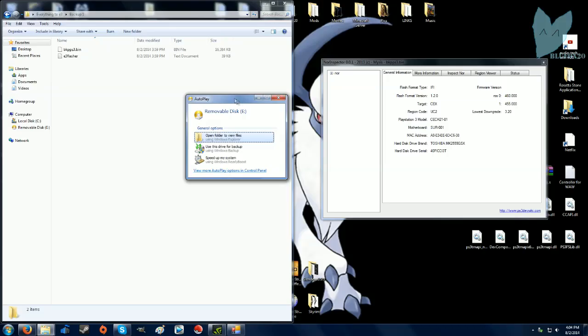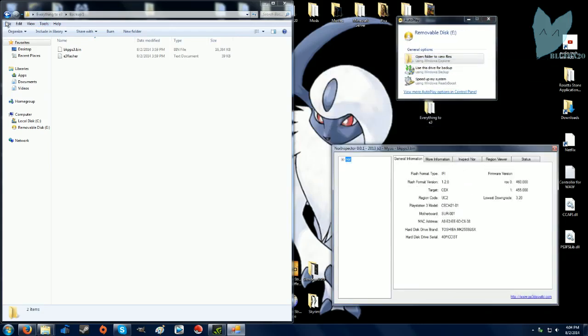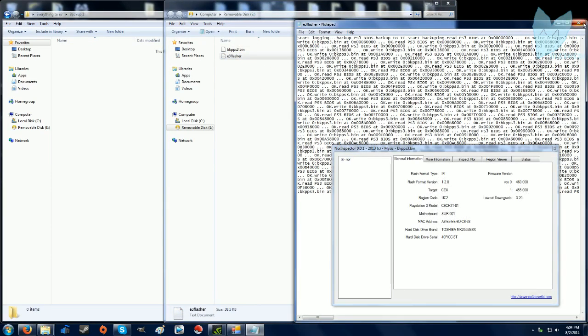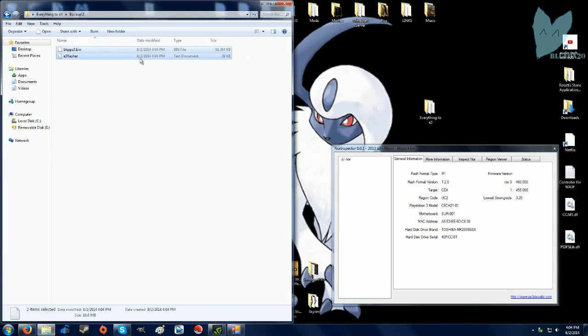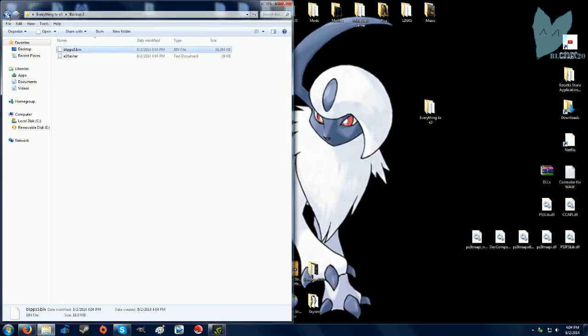Okay, I'm back at my computer. I'm gonna open up my backup 2 folder because I want to save my backups. Everything looked okay in the E3 flasher text. Gonna drag it into the folder and delete it off my micro SD card. And then I'm gonna drag it into the NOR inspector. And again, everything's okay, looks good.